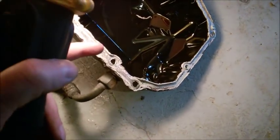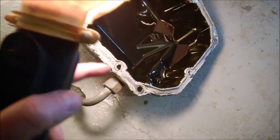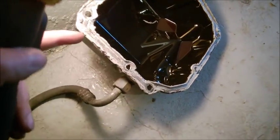I already did this once. I'm not going to scrape this old gasket. I'm just going to get something like a brake cleaner to remove all oil around, and I'm going to put the new RTV over this old one, because this one is hard to scrape from the cover. However, on the transmission side, I want to make sure everything is clean. I'm going to scrape everything in there, all the old gasket, as much as I can, and then I'm going to spray, because you cannot reach all the surface with something like a thinner or something like that. So I'm going to spray carefully with, let's say, brake cleaner, just around the area I cannot reach with my hand with a towel or something. So I'm going to spray just on the side where the mating surface is, especially on the sides here. I cannot reach with my hands.